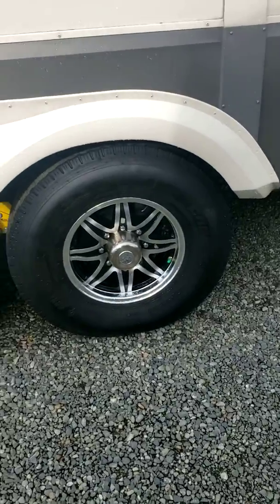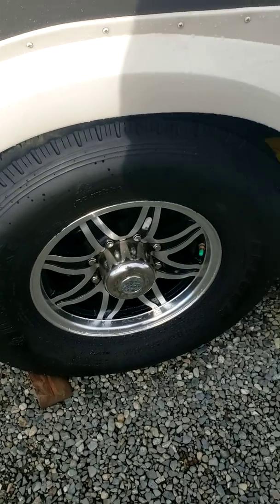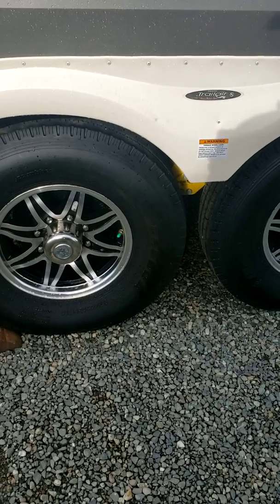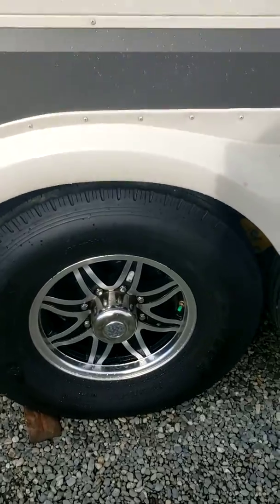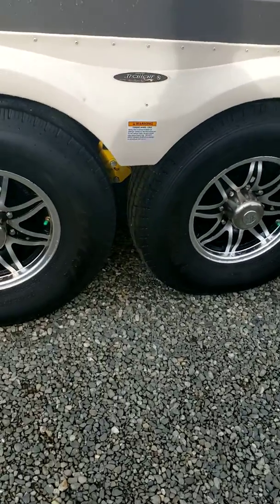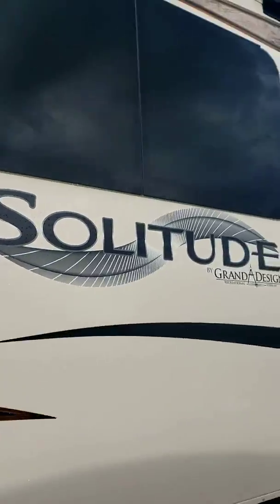Okay, so you've got wheels. On this one, we did replace the drums on the front axle. There was a rock stuck in it, and it gouged the drum. Whatever you do on one side, you have to do to the other. So we did the bearings, we did the drum. It has brand new brakes on the front, and the back has been re-greased, and everything's been torqued. The wheels are good to go. You guys are ready to rock and roll. Jack back here.